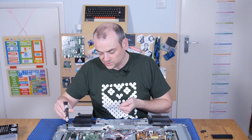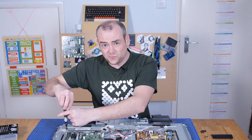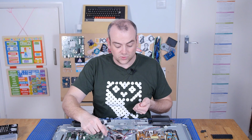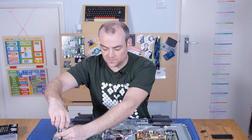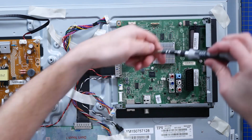Internal display connectors still often follow very common standards. So there is an internal display port, there is a DSI port, and they're very often interchangeable. So it would have been, theoretically at least, possible to swap this motherboard with a different driver with the same connector, so long as you had the same power requirements, same space requirements. Wi-Fi may have been an issue, but not to say it's impossible to overcome.